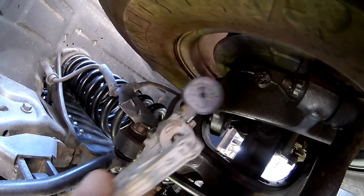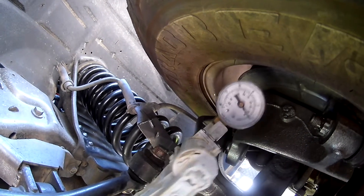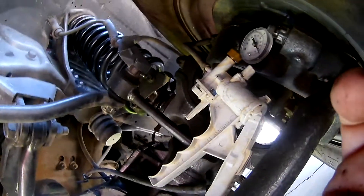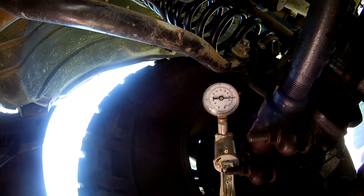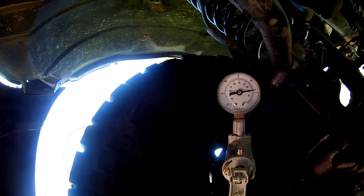Okay guys, I'm going to give this thing some vacuum — and not getting any vacuum here. I mean, I would have heard some sort of leak but I'll say that hub is not looking good. This is not holding vacuum; as I pump it the needle should be going up. Now I'm back at the passenger side hub, creating a vacuum on there, and nothing. So I think both sides of this thing are leaking.